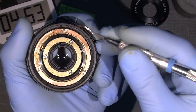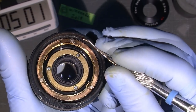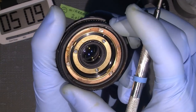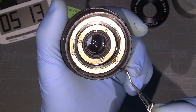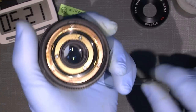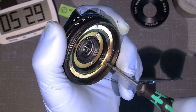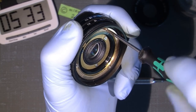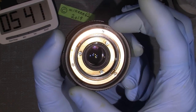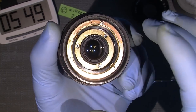It's also good to set a mark on the actual plastic focusing ring here, because when we loosen the three screws, the focusing ring — the plastic part — will move, and that's the idea. I'll just loosen it a few turns; it's not necessary to fully unscrew. From now on the plastic focusing ring is actually loose, meaning the focusing helicoid will not move at all on its own.